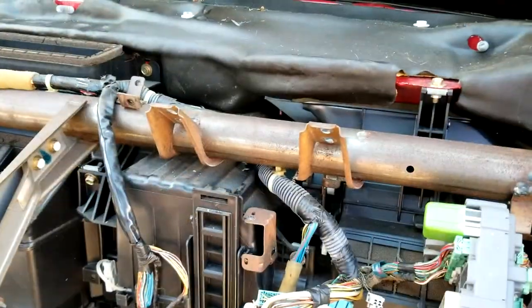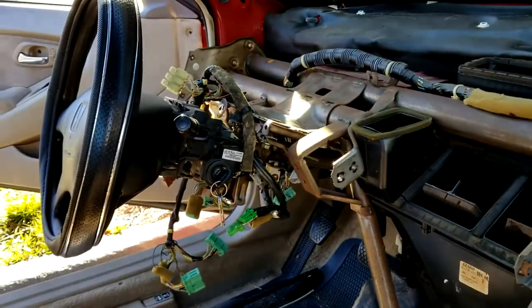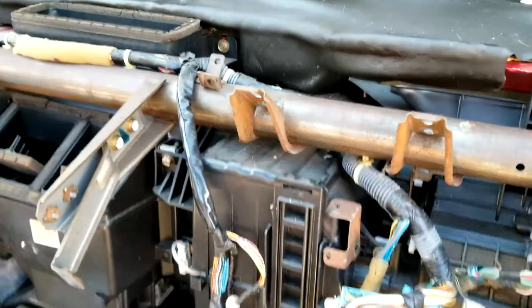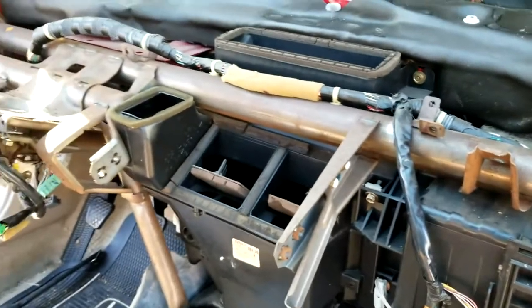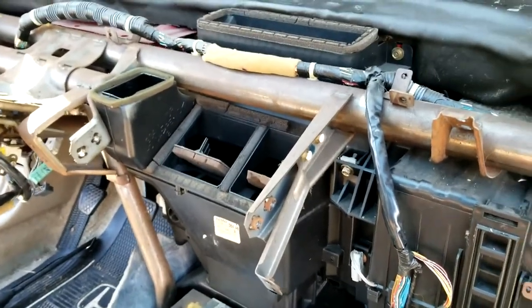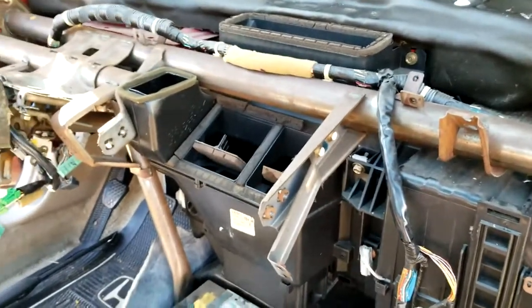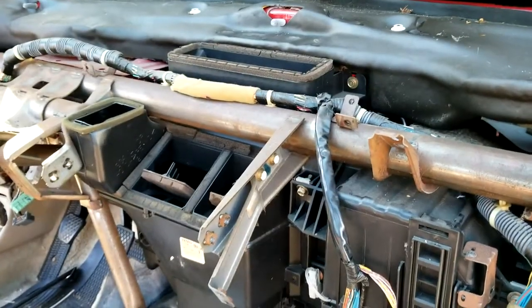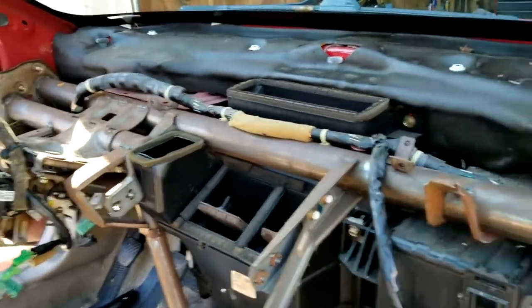One last thing before the heater box comes out: looking at everything very closely, it looks to me like this entire reinforcing bar has to come out. It holds the steering wheel up, runs from one corner to the other, and has the fuse boxes connected to it — and the manual makes no mention of it. So I think that's probably going to be our stopping point for this video. If you guys are smelling a two-parter, here it comes. It's going to be a lot more work to get to where we need to be. Check out my next video — it should be the conclusion of this big mess. Thanks again.